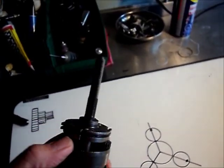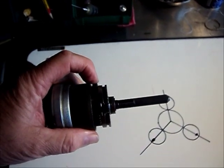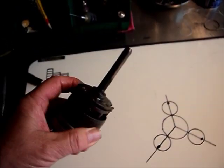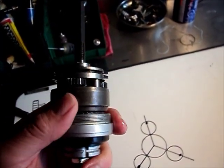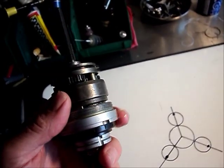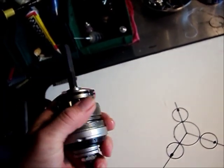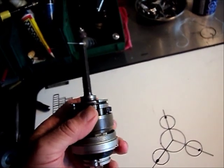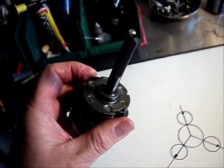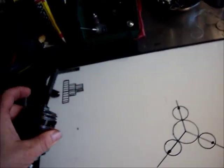Three-speed hubs are also not a concern, because while they do use planetary gears, they do not have stepped gearing — they have only one sun gear and one corresponding planetary on each shaft. The exception is the S3X fixed-gear Sturmey Archer, which does have two sun gears. Basically it is simply a five-speed hub with no drive pawls on the ring gear, and the planet cage is splined directly to the hub. But it also has one of those sub-assemblies, because it's modeled after the wide-range five-speed. So the fixed-gear three-speed has a complete sub-assembly with the sun gear as part of it, so you don't have to worry about timing with that.